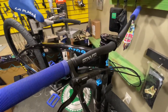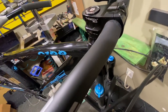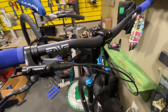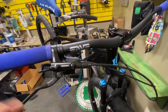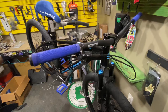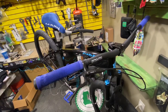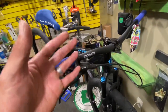We had to have a super solid, super short stem, so we put the Thompson Elite stem on here — 50 millimeters reach, so it's nice and compact so you can work the bars and swerve easily. Next we have the Envy M9 carbon bars. These are super lightweight. The stock C100s have an aluminum handlebar and a really heavy fork, so putting carbon bars on here makes the front end really light and agile — it just swings around like nothing.